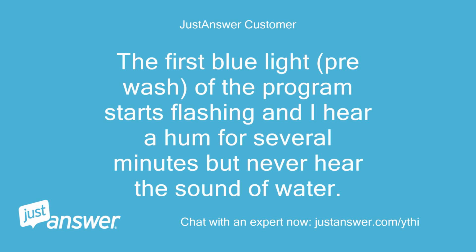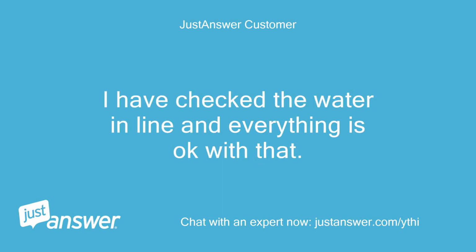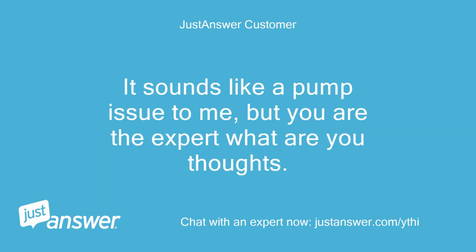The first blue light, pre-wash, of the program starts flashing and I hear a hum for several minutes but never hear the sound of water. After a couple of minutes the program jumps to light 3, rinse, which flashes along with an audible beeping. I have checked the water in line and everything is okay with that. It sounds like a pump issue to me, but you are the expert. What are your thoughts?